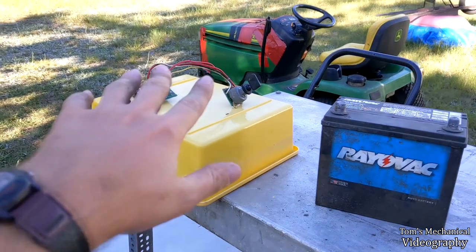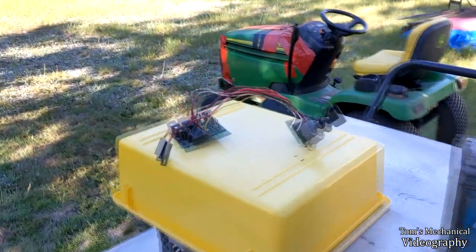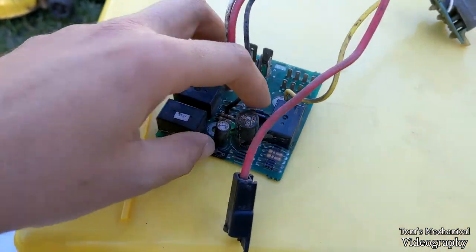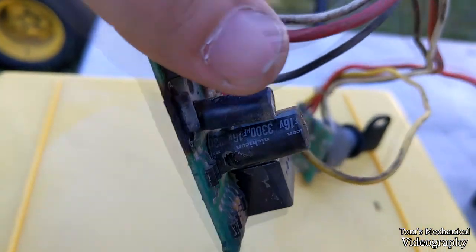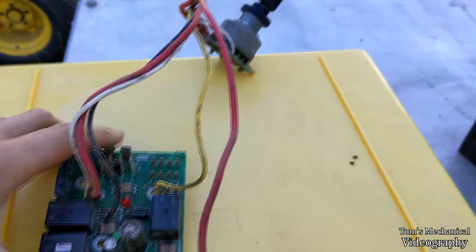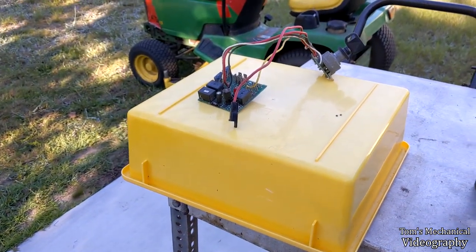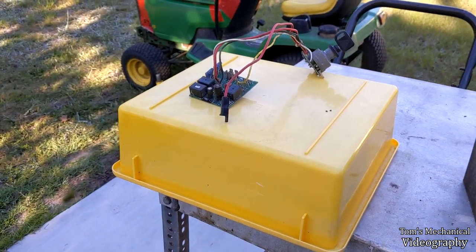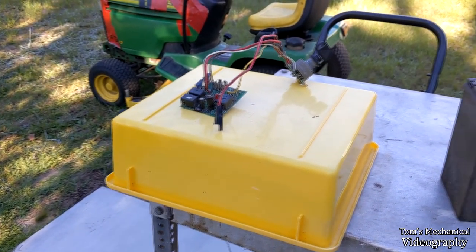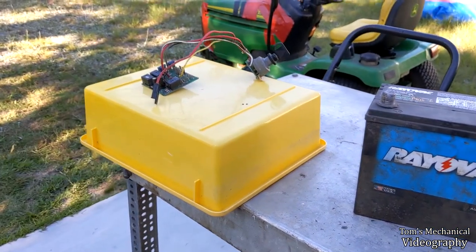Alright, well, I'm going to attempt to repair this. I'm going to give it a try. At least I'm going to go look up, see if I can find any... If I cannot find anything on what these two resistors are, then I'm kind of out of luck. Thankfully, this capacitor has stuff printed on the side of it, so that shouldn't be too hard to replace, but those resistors are going to be a lot more annoying just to figure out what they are. But if I can find a spec sheet on this board, then that shouldn't be an impossible feat. And I mean, just replace those three and just hope for the best.